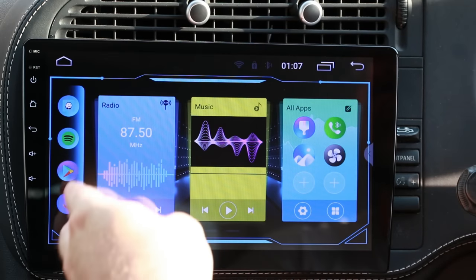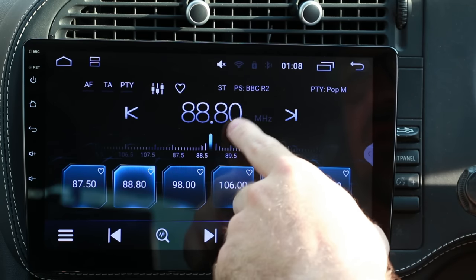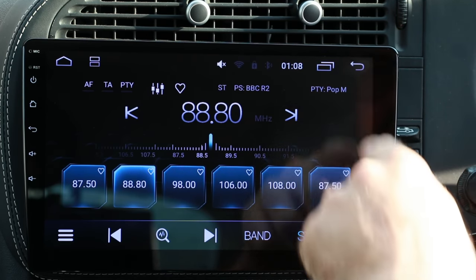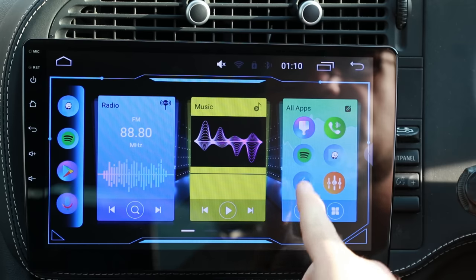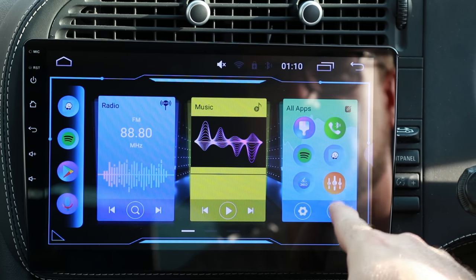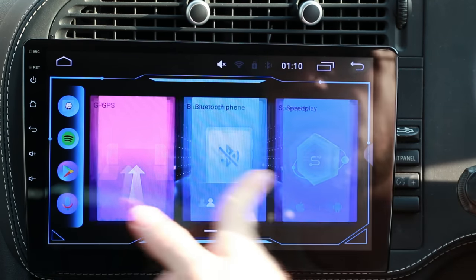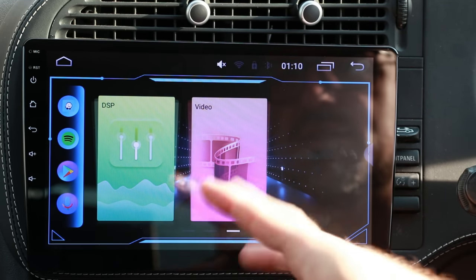The dashboard is pretty useful. On the left hand side it shows you all the apps you've recently used. The second one is radio — it does give you RDS, you can see 88.8 is actually BBC Radio 2, though when you save frequencies to preset buttons it will show the frequency rather than the RDS station name. This one is for local music like MP3s on a USB stick, and this one allows you to choose six apps you use most and change them by hitting edit. We also have GPS, Bluetooth phone, Speedplay — which connects to Android Auto and Apple CarPlay — DSP for the graphic equalizer, and video playback.